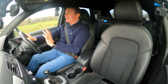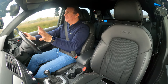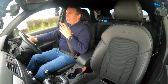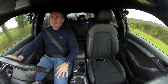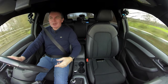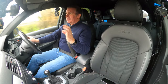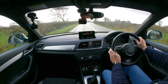Mr Brewer was a lovely chap — he got a new car every year and the first thing he'd do was take it home and clean it, even after we'd cleaned it. He'd polish the rocker cover, chrome all the pipes underneath — absolutely beautiful. He bought an Opel Manta and there was a noise from the back at a certain speed. The mechanics couldn't find it, so it eventually came down to me — only young at the time — having to ride in the boot while the mechanic drove up the road. Not very pleasant being in a boot, especially back then when it was mostly all metal. Anyway, we tracked it down — it was the rear springs juddering and touching.